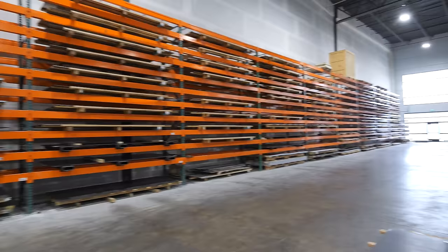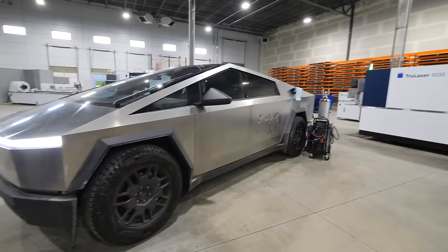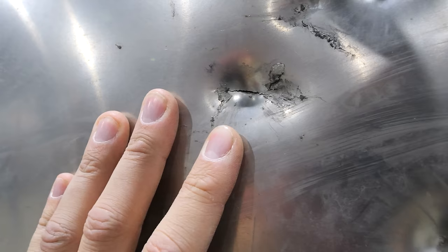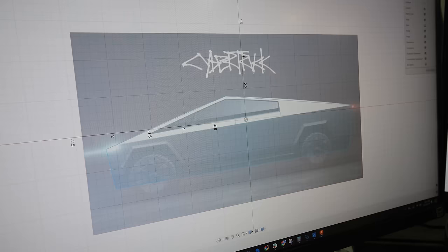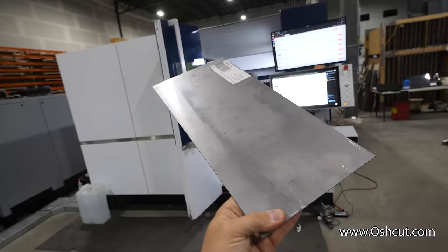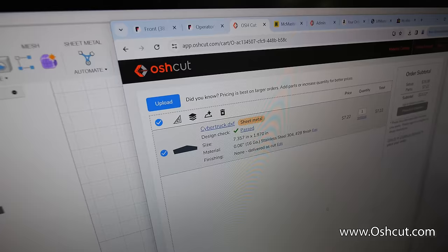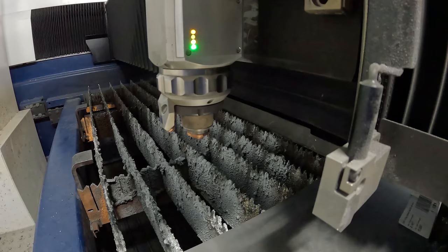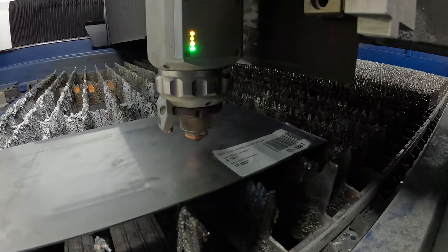The reason we pulled the Cybertruck into this particular warehouse is because we're going to patch the bullet holes with lasers. This video isn't sponsored — I've just been friends with the guys at Oshcut for a few years and they let me use their massive metal laser cutting machines. We decided to use a Cybertruck-shaped piece of stainless steel to patch the stainless steel door. We upload the drawing into Oshcut's online portal, and within about 3 seconds of laser time and about $25, the stainless cyber patch is ready. The patch just needs to be large enough to cover the .50 cal hole, the .17 hole, and the .223 hole — since my superior grouping ability put all three pretty close together, we can get the entire job done with just one patch.